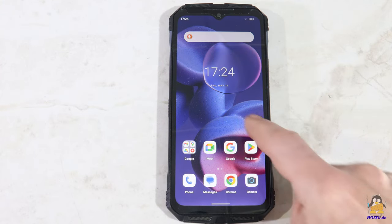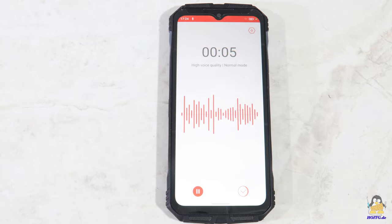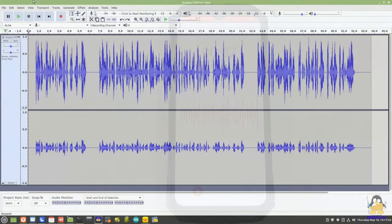To give you an idea of the audio capabilities, I will now switch off my studio microphone and record my voice with the V30T's microphone. The first test recording was made with the preinstalled app called Sound Recorder. The stereo soundtrack is saved by the V30T with a sampling rate of 48kHz as an MP4 variant with a bandwidth of 128kbps. The filename extension is 3GA.